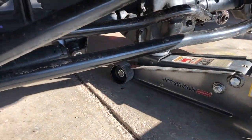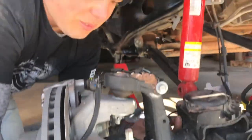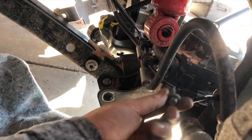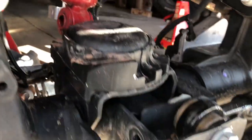You have to drop the axle pretty low to the ground — we can go higher with the jacks — to get the spring out and everything. I'm going to take this little brake line bracket off back in here in order to get the bolt from the bump stop through down into that. Finagle your way down into there.